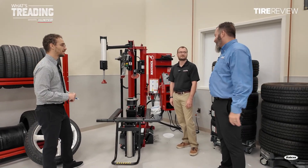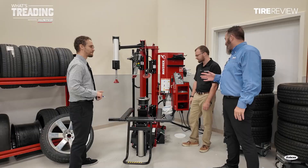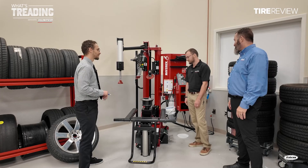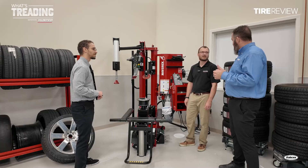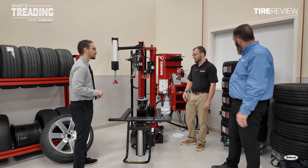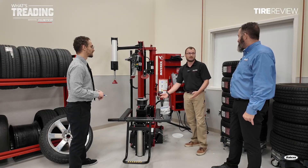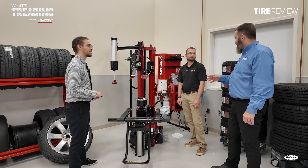Thinking about heavy tires and wheels — if those rollers weren't moving freely, you'd really have to pull. That thing is smooth. The light — I wasn't a believer when I first saw it, until you see it illuminate. We think about overhead lighting in a shop illuminating everything, but what happens when you put a car or a wheel over top of it? That light is a game changer. It was feedback from people saying it's difficult to see that rim-tire interface when using the mirror. Techs were still getting down and feeling that interface, which poses a danger — you don't want to get a hand where tools are moving. When I activated it and saw that illumination reflected through the mirror, it changed everything — I could see exactly where I was on the bead bundle.